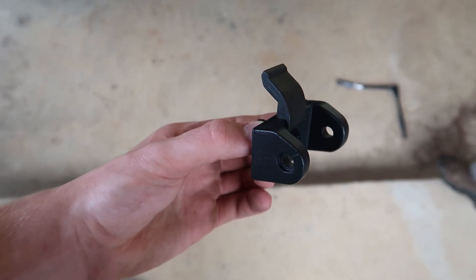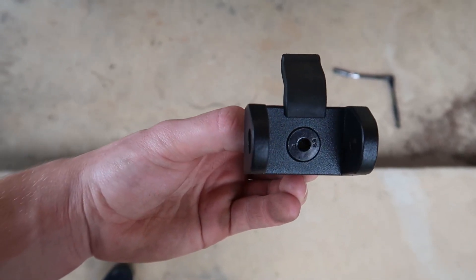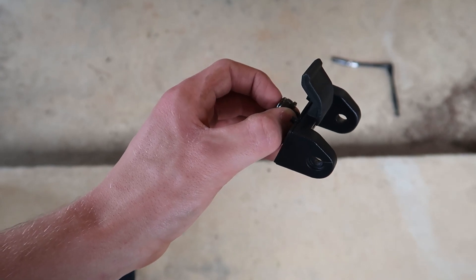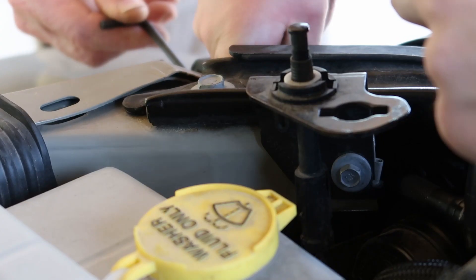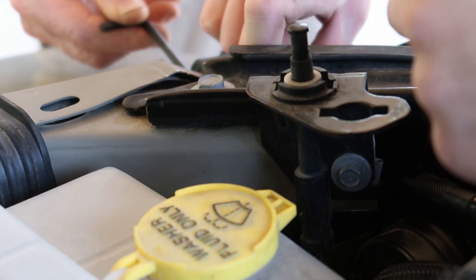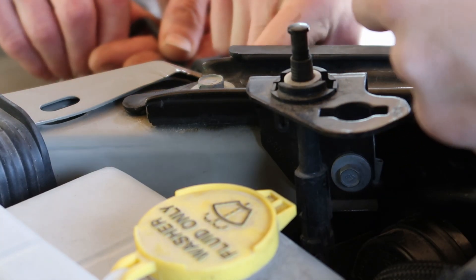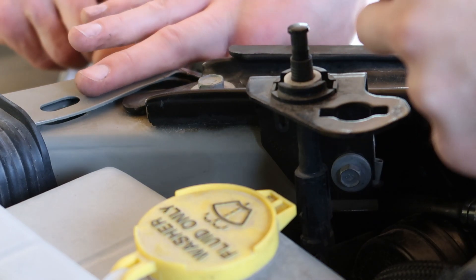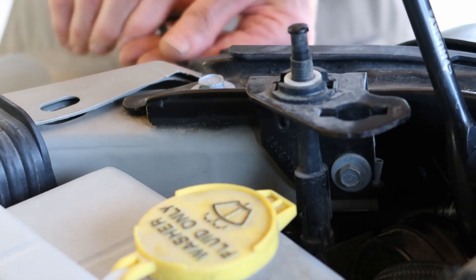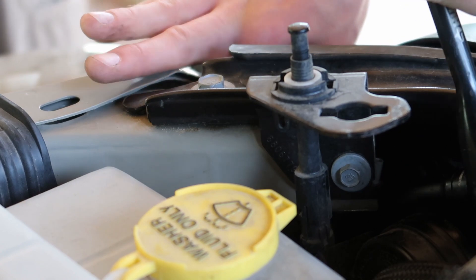There they are, and this comes off like that and we're ready to install it. On the new hood latches we have to poke the bolt through the body panel, then we can hold back up on this and tighten up the outside bolt with a 5 millimeter Allen key, so you don't have to do all the ratcheting in a very constricted spot. We've got the nut on the end of the bolt for the hood latch and we're about to put on the swivel so we can hold back up and tighten it up with a 5 millimeter wrench. And that is tight — we have the first bottom part installed.